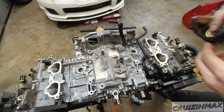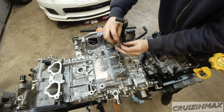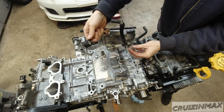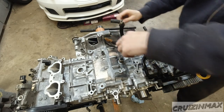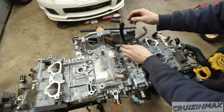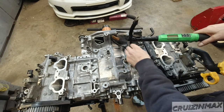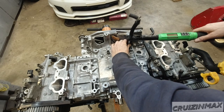Let's take care of the knock sensor — no oil, nothing, no washers, just a sensor and a bolt. Looks like a 12mm. You want to position it the same way, which I've noticed is almost always about 10 o'clock. The torque spec is 17.4 and you want to be precise for the knock sensor.